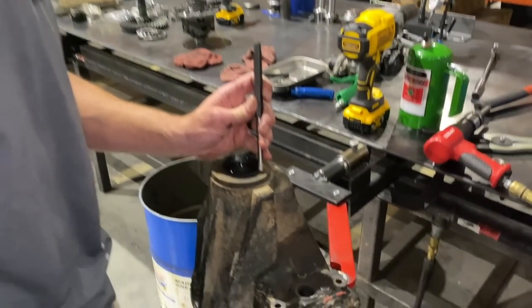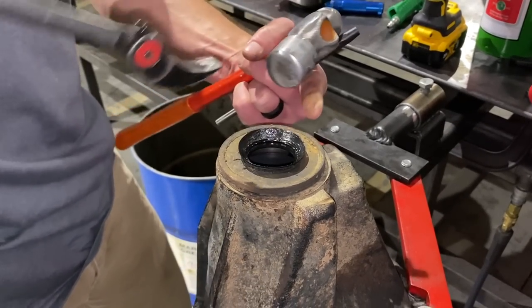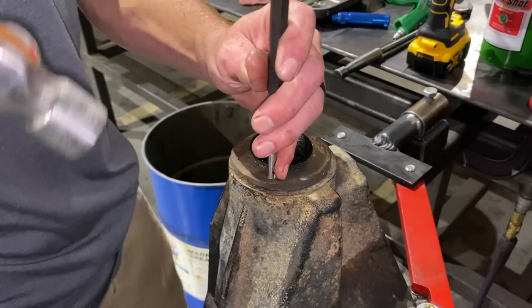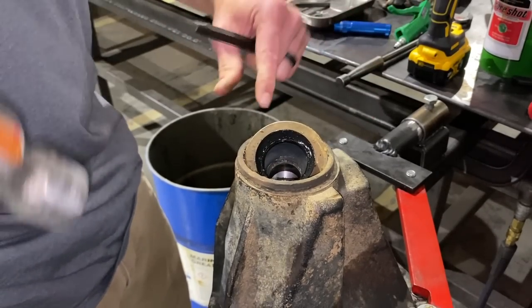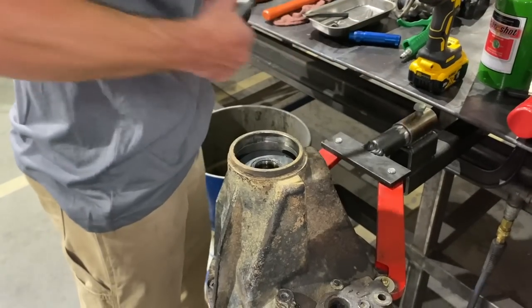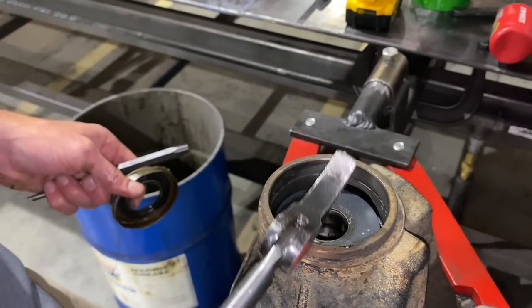Here's one of those things I like to tell people about — removing a pinion seal. Pretty easy with a seal puller, but you want to make sure that you don't stick a seal puller in something like this where it drags this casting, because basically you can drag it and you'll create a groove on the OD and then the oil will try to leak past it. So if I'm removing a pinion seal, I always beat it down on one side and then it wants to pop out to the other side — there's no chance of me damaging that surface. And so if you get underneath this thing and drag your tooling across this machine surface, you can create a groove for oil to leak past. So you just want to protect this machine surface so your seal seals nicely.